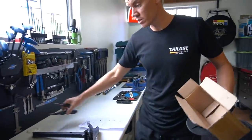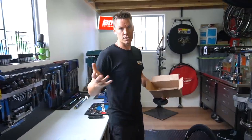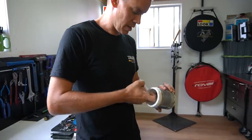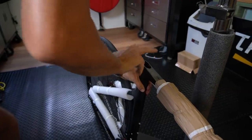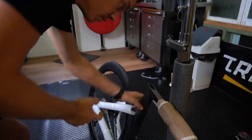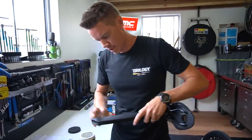There's no carbon paste or assembly paste included — you're gonna need to use or buy some from a shop. This is a Finish Line carbon paste; it smells disgusting. It's a high-grip paste and we use different grip components here — some are very fine, some more aggressive — and it just gives a better hold on the seat post.